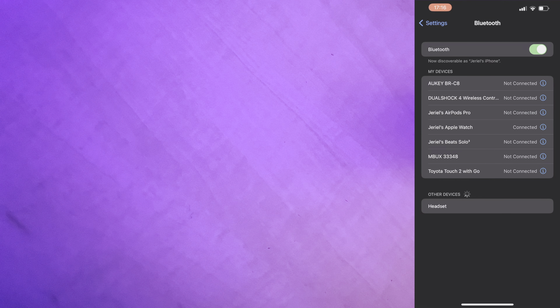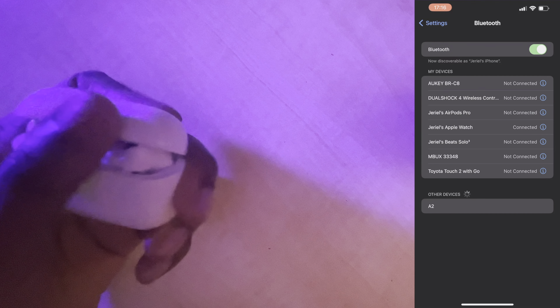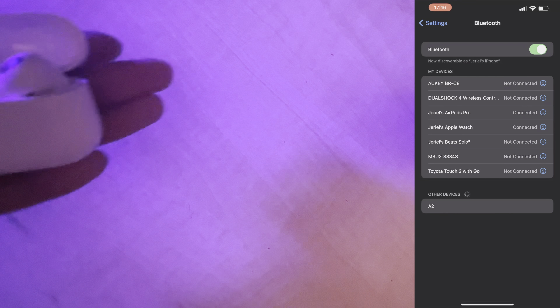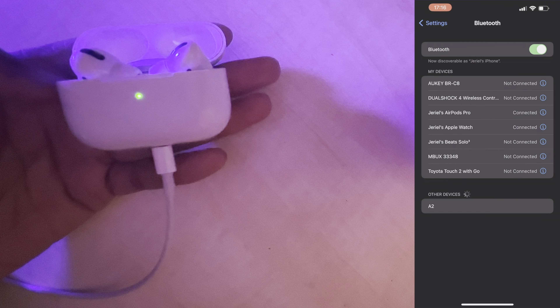Now let's get ready to update our AirPods. Get your AirPods and make sure they're paired to your device by opening the lid until the pop-up is displayed. Then plug your AirPods into your lightning charger. I've found that the update occurs when it's plugged in via lightning and not by a wireless charger, so make sure you do that.